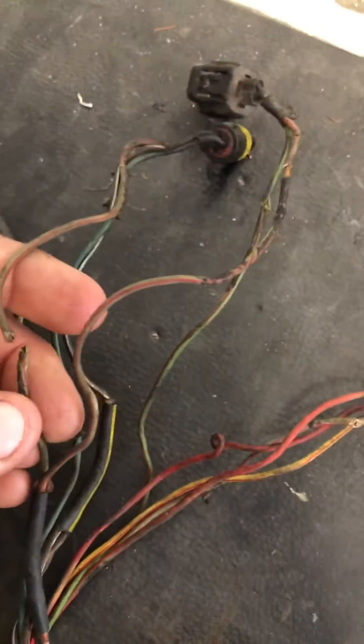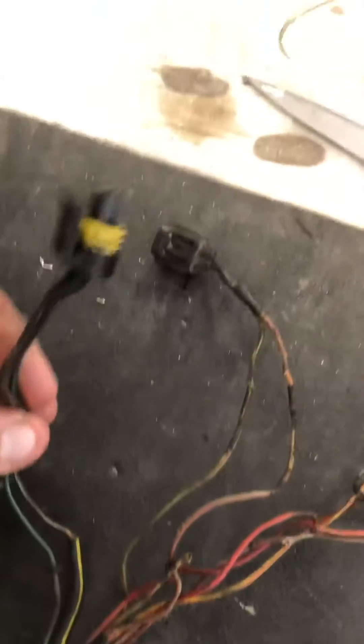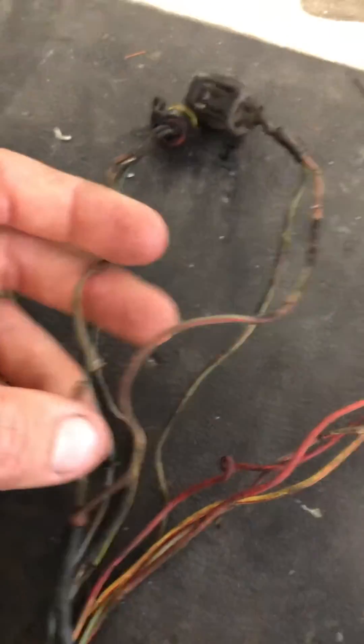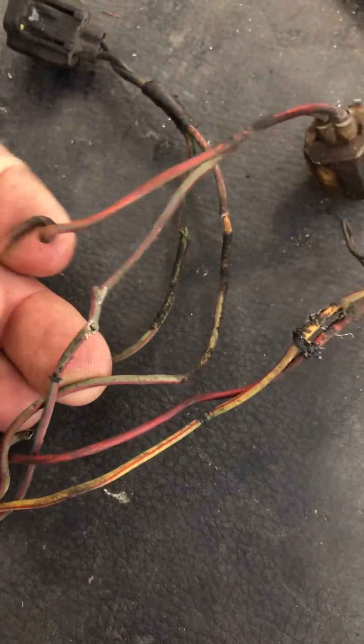This wire here is completely broken — I forget which sensor this is, I made another video so I can put this thing back together. Those are supposed to be connected and that was gone. These wires here are all chewed up — you can see we got a break there, we got a break there, they were shorted out, and there are a couple others that are all banged up.